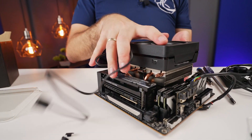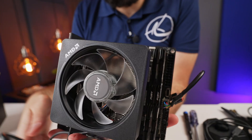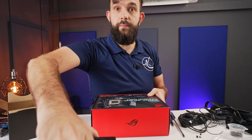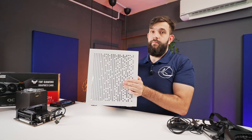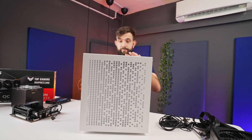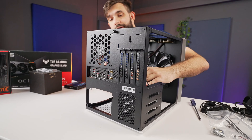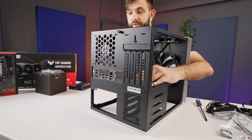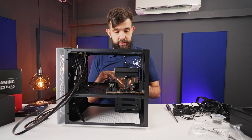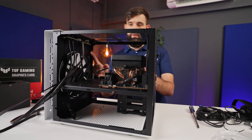For RGB, there are two RGB ports at the top of this board — standard RGB and ARGB. This case uses an ARGB connection. With the cooler installed we can now proceed to install everything inside the case. This is the Cube case — let me take off all the panels. You can remove essentially everything to get access. It almost feels like ASUS and Techware have spoken to align the colors, because it looks really clean. Let's carry on and install the graphics card — actually, I didn't check, there's not that much space. I wonder if our graphics card is going to fit.